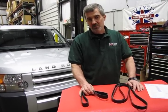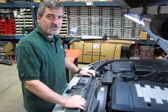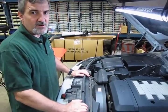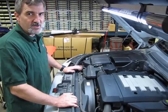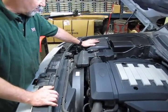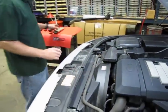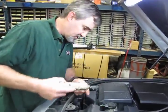We're going to show you how to install these belts on your vehicle. You've seen the kit — the two belts — and we're going to give you an idea of how to install them yourself. It's really not that bad a job. This is an '06 LR3, but this application will work from '06 to '09 with a 4.4 V8. First thing we're going to do is remove the intake and the air filter cover — they basically call it a muffler or amplifier — out of the way so we can access and remove the upper shroud. This consists of about seven Phillips screws; you want an extension on there.